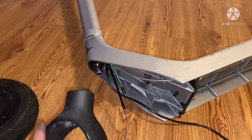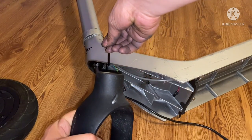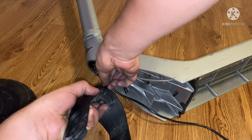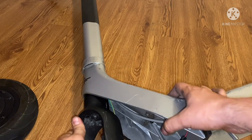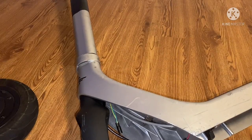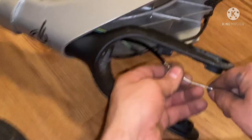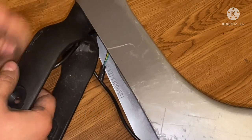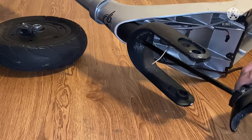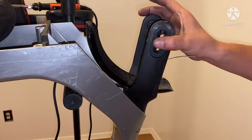Now I can shut my scooter and work on the bottom. Let's go ahead and seat the front brake cable by putting it right into that slit. Now that that's in there, there's a slit that will automatically catch and once it does, you know it's in place. I also want to insert this front brake cable from right here — feed my wire in. There you go, that sits there just like that. I have my fork on now — going to add my plate and put the front tire on.